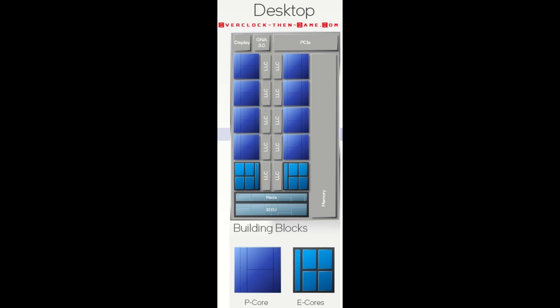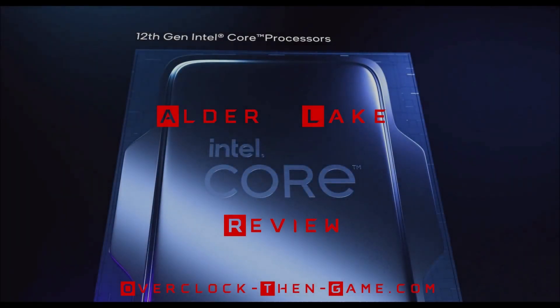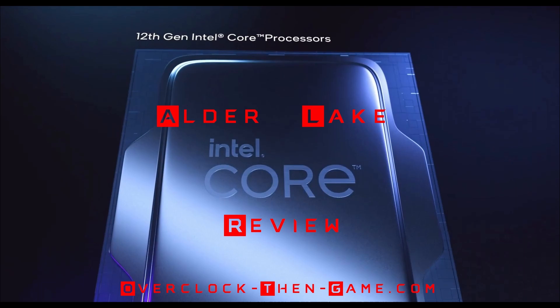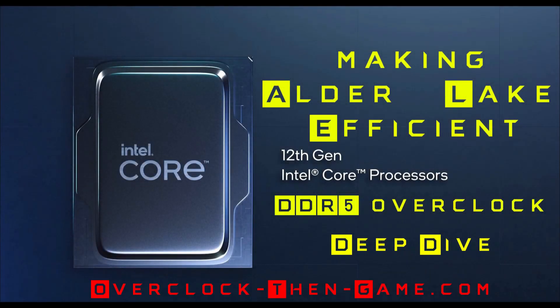This deep dive was done for two reasons. First, Alder Lake S is Intel's brand new desktop variant of their hybrid technology. Second, the current software has not yet begun to fully utilize Intel's new microarchitecture with the big performance cores and the little efficient atom cores. I decided to perform my own personal benchmarks and skip past software limitations as much as possible to extract as much information as I could. Although not all software utilizes Alder Lake S microarchitecture properly at the moment, I could still show the exact increases at the microarchitecture level to give a better representation. I believe there are still more ways to gain performance with the low vCore settings, such as the ring bus and other various settings to tweak. This is only my first week of tweaking settings while undervolting and overclocking, so stay tuned for future videos.